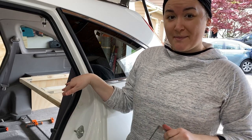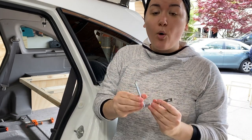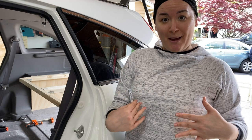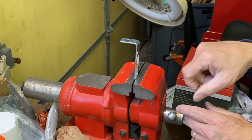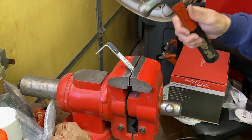The next thing we're trying to figure out is how to connect the back piece to the front piece. We're going to use these brackets so that the back piece just kind of drops into this. We're going to bend the end — this will be connected to the middle piece. The whole reason we're doing something like this instead of just connecting it all as one piece is because my spare tire is in the back, so we really want to be able to take that back piece out easily if needed. We clamped it in the vise and bent that little corner of excess material — by bending it up it'll help keep it a little bit stronger.